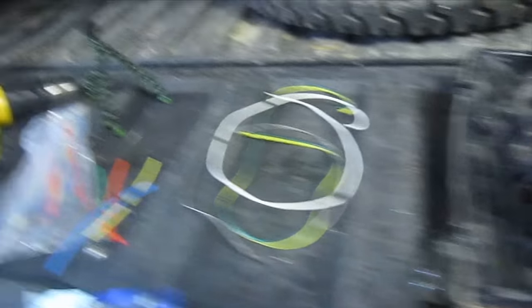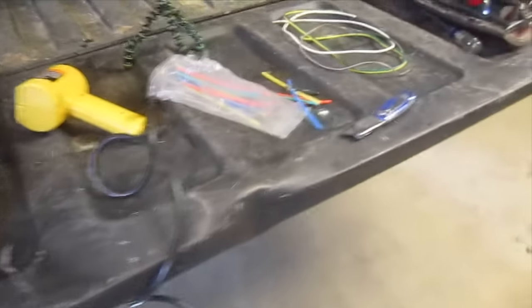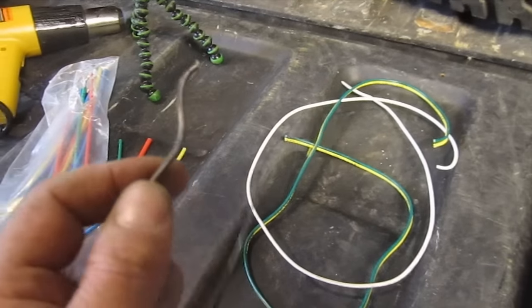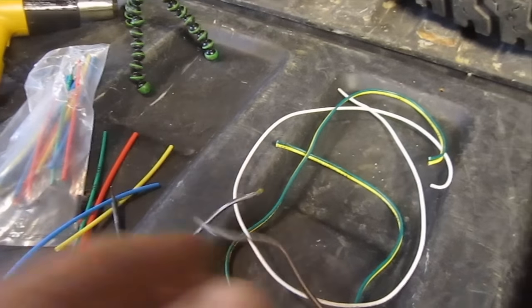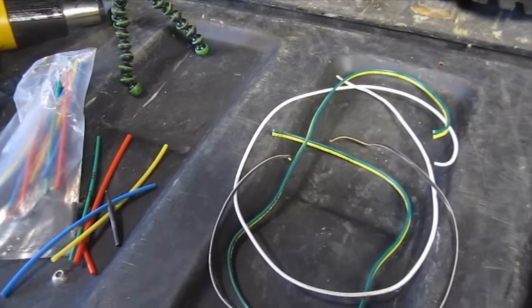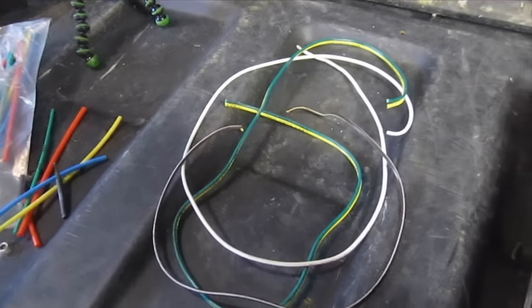Just a quick check-in — you can see I'm making progress. The tail lights are the brown wire and I've got that all done. I'm basically using shrink tubing. Instead of doing one big bundle, I'm actually splitting it off and creating a Y, then going off to the various parts. So instead of having just one big ball of wires, which is what this was, it also gives me a little extra length on the jack. Let me just keep going, and then I'll show you what we should be seeing out of these jacks.